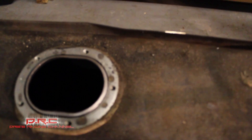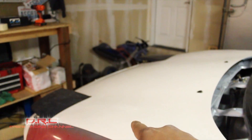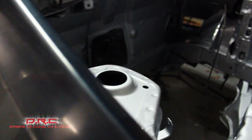I'd like to eliminate the fuel pump inside the tank so I wouldn't have to drop the tank anymore, but I really need a good fuel filter. This hole right here isn't really that big. I know I'm gonna spend a lot of money on lines, but if I got a fuel cell I'd have to spend even more to route lines from all the way up here, under the car, and all the way back — I'd rather just keep the stock-placement fuel tank.